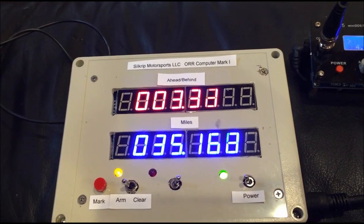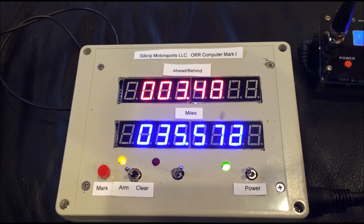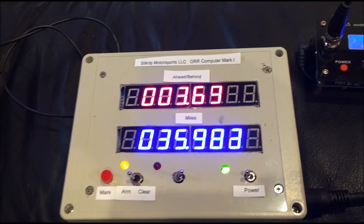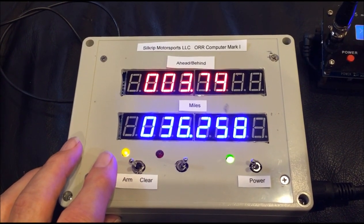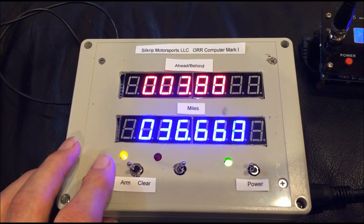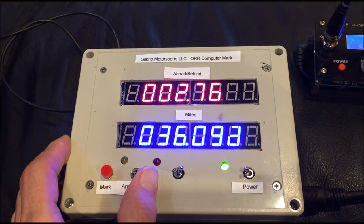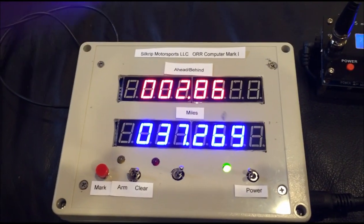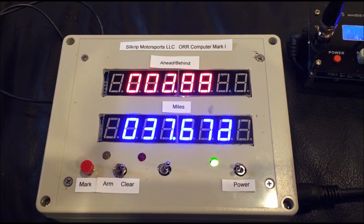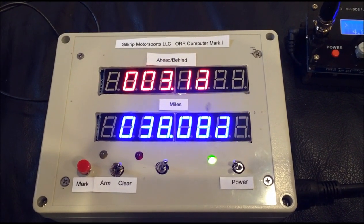As we get close to flag station 4 and the big left-hand curve, we're approaching this waypoint. I'm going to show you a simulation of being late as we go past — it should be at 36.6 but I'm a little bit late, to show tire expansion issues. It corrected the time and mileage but also recalculated the mileage factor, using a new mileage factor for the tires at this point.